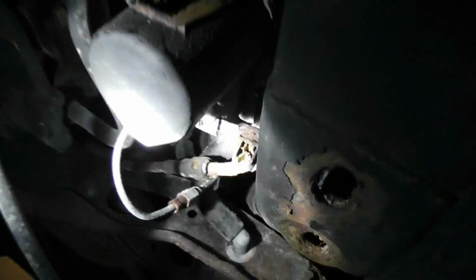I'll show you something I did notice on this. This is the worst spot for fuel lines, everything else, right where it curves up. All your brake lines and everything, these are really good. They actually look like they've been replaced. Somebody did it proper. Put a tube around it if you're gonna hold them together, because if metal touches metal, it's just a great spot to start rusting.